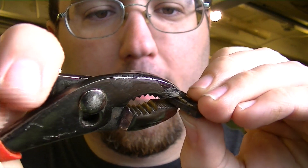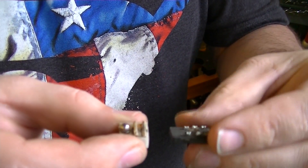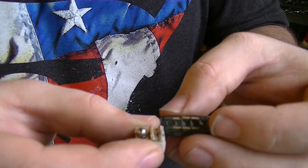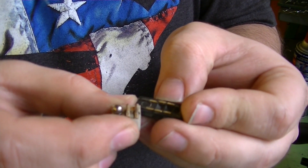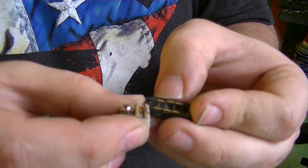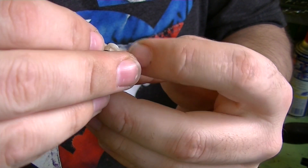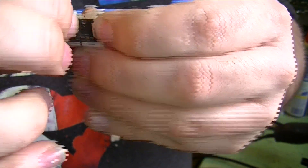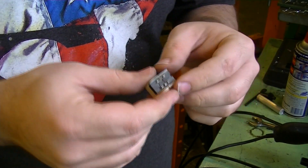Now we can actually go ahead and test this. The heat actually raised the contact pads inside — I'm just going to push them back in place. Here's the inner workings of the headlight switch — there's not much to it. It's just a ball bearing detent, a couple of bus bars, and six pads. So I'm going to have ground along one bottom side, a single pad up top for low beam, then one covering high beam and low beam together, and one with just high beam. I'll bridge that connection for the low beam so when I push it over I have low beam, and when I go to high beam I have highs and lows together. So we'll put this all back together — I'll make sure I keep my ball bearing detent in the right way. It'll just snap back in and get that nice click.